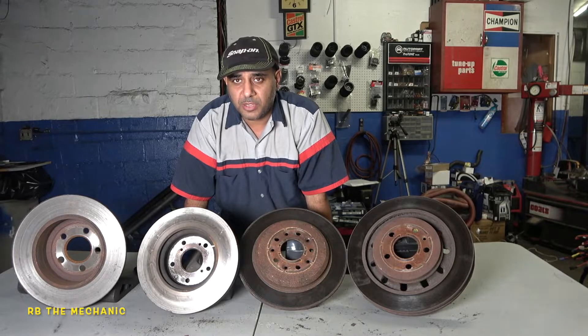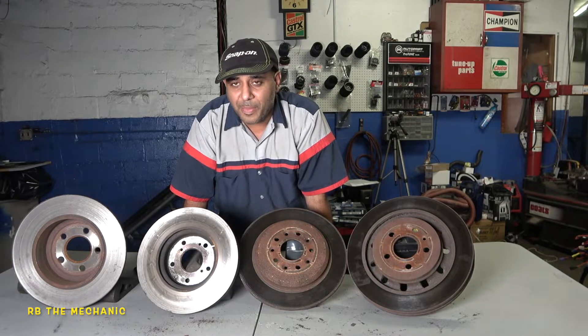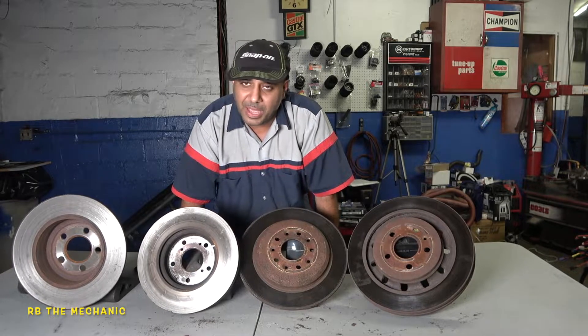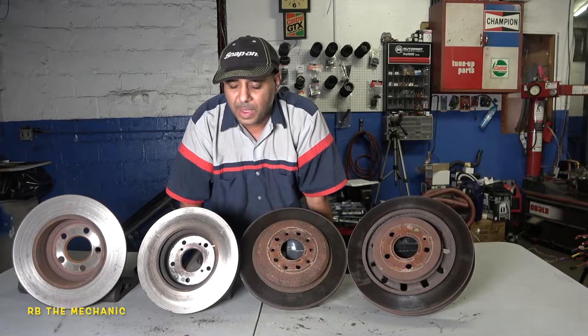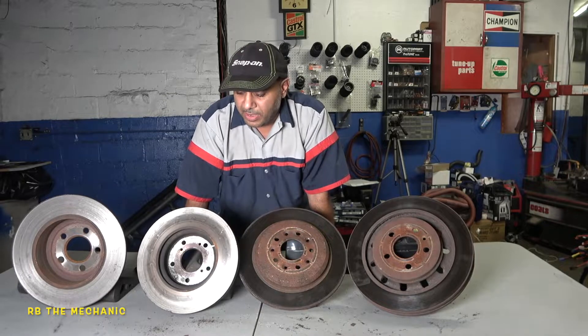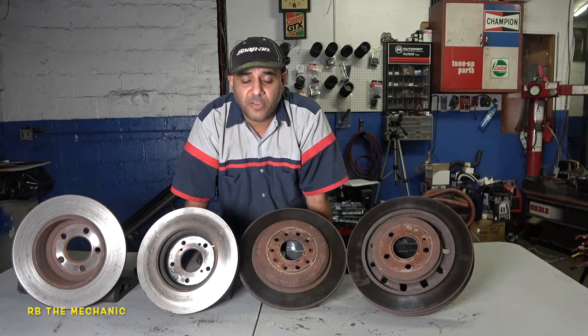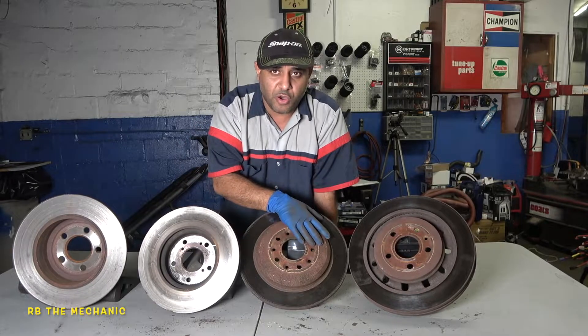The best thing to do is next time you get your brake job done, replace the rotors with it. If you replace the rotors and you've only driven about ten to fifteen thousand miles on them, maybe give it another brake pad slap after that — then get rid of them. Hopefully this video gives you a little bit of information and courage to check out your rotors.